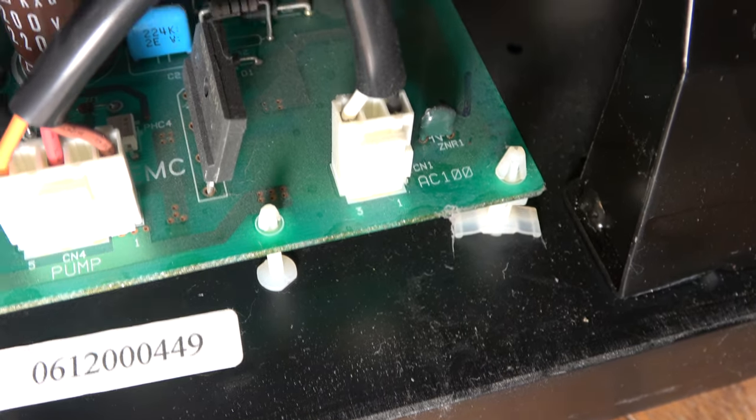Not yet, no. It's going to be on the main board, isn't it? These connectors here are going to be drives to the motors, I should think. I'd be surprised if they carry 5 volts. This might well do. Okay, just a giant IDC connector. Unplug that. That's our 5 volt line now. Still not there. It's going to be on the main board. Okay, let's unplug the remaining connectors then. Okay, I've unplugged everything bar the power supply connector, I believe.